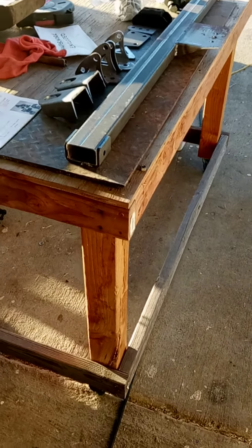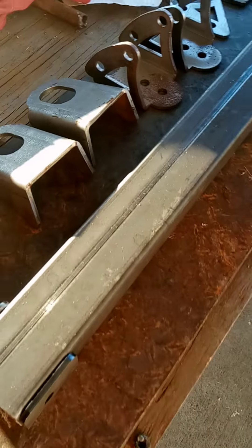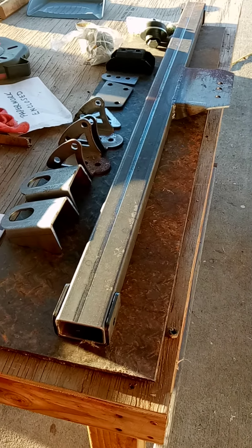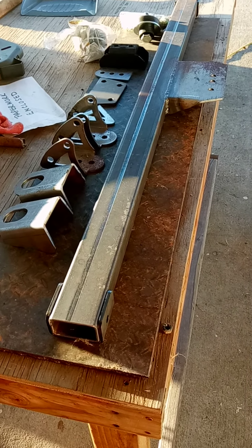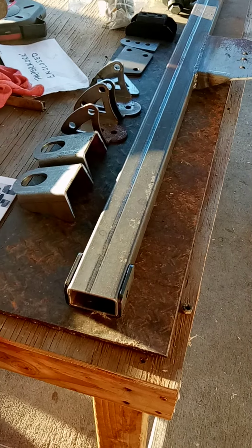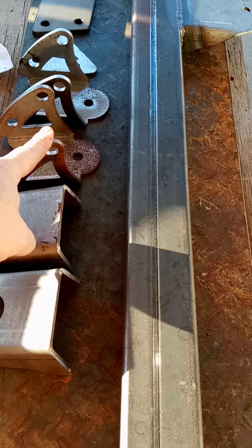This is going to be a short video. I got a kit here from Butch's Cool Stuff — basically an install kit where you can put a LA style small block Mopar engine into a classic car. They have multiple years available, but mine's a 55 Plymouth Savoy. The kit comes with welding engine mount tabs and engine mounts that bolt to the engine.